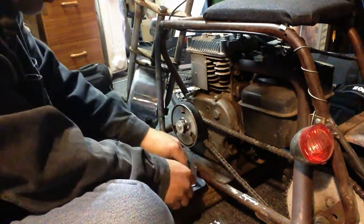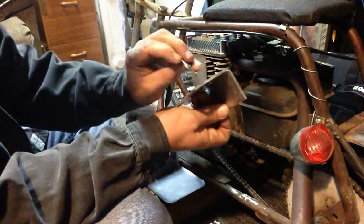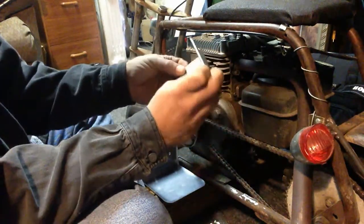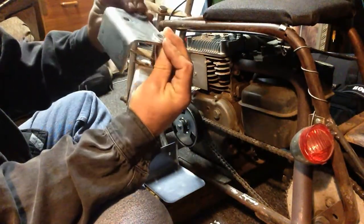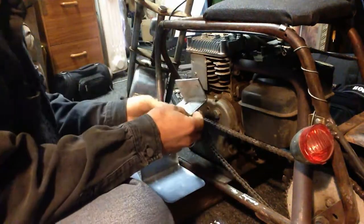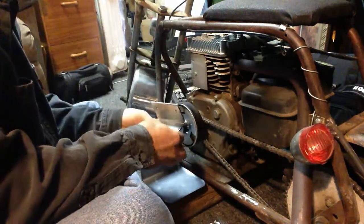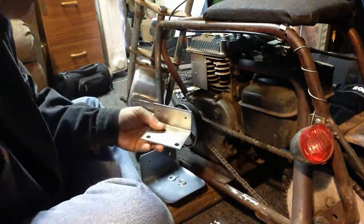All right. I'm going to slip some washers in the back, just bring it out just enough to keep that bolt off. I'd prefer a little bit longer, but I could go one more shim, but then it really sticks out. So this would be the bare minimal right here, and we don't want to put that on yet.